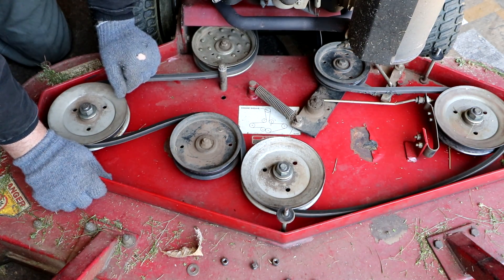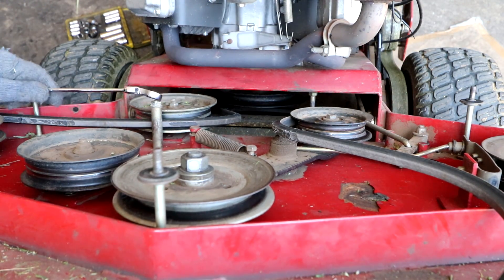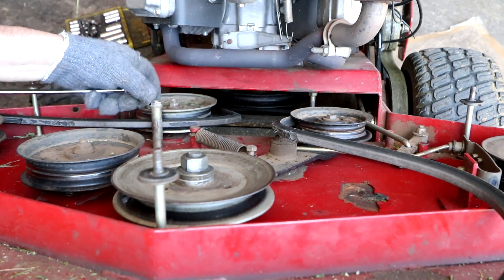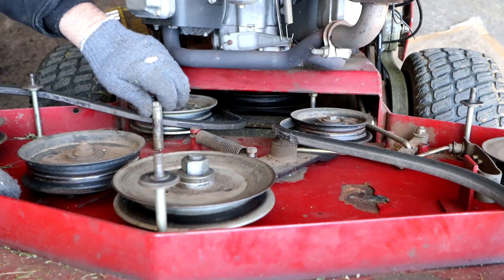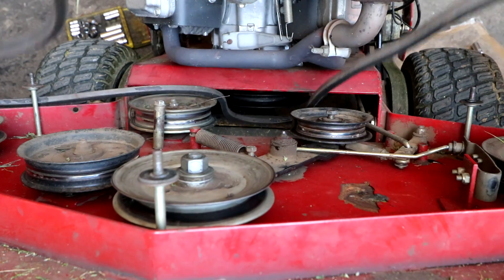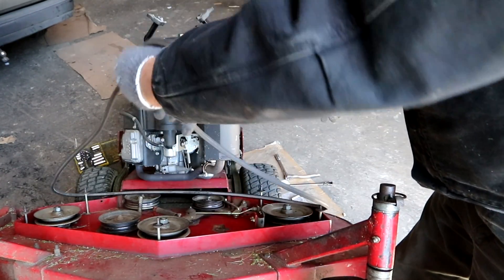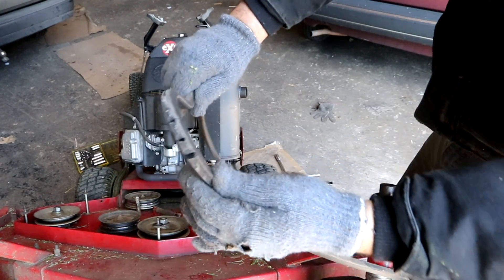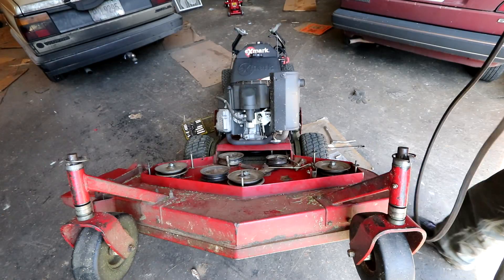It's actually pretty easy to change. So what we've got to do here is take these couple of pins that keep the belt from flopping off when it's running — loosen those so we can get the belt out. We've got those two loose, and voila — the old belt comes out. This is why we're replacing it: it's starting to break up. Just a matter of time.